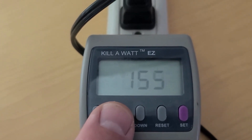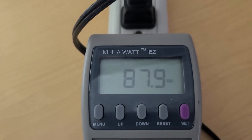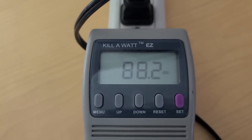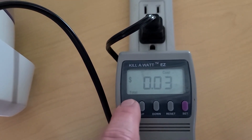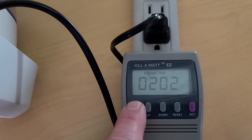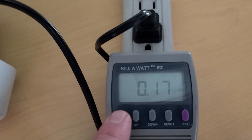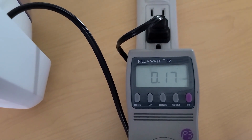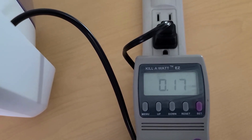So we're at 113 volts and it says we're using 88 watts right now, which is a little bit more than what the label says. We'll come back in two hours and we'll see how much power it used — so we're using 83 watts. A total of three cents if I was running it in the house. It's been two hours and two minutes and we used 0.17 kilowatt hours. So to extrapolate to 24 hours, we multiply that times 12 because we've been running it for two hours, and that would tell you how much you use for a whole day.